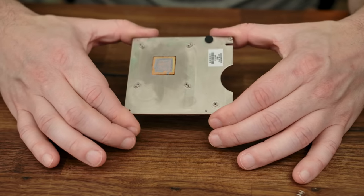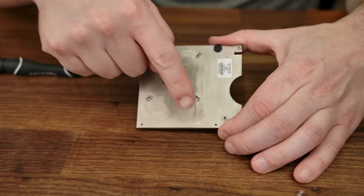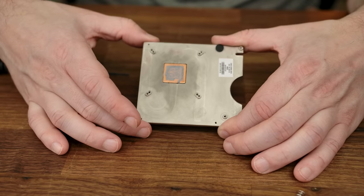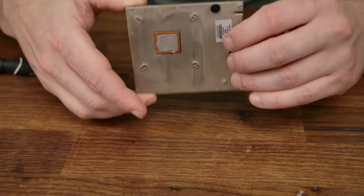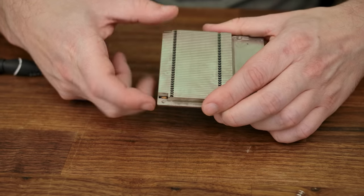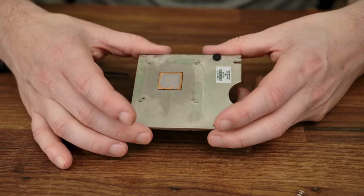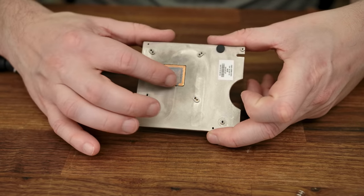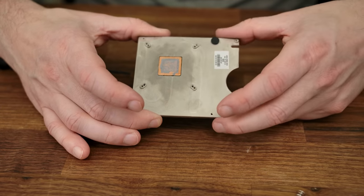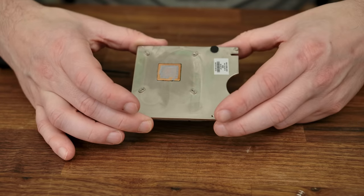Now, I'm already seeing one minor difficulty in completing this project. You see this smoothed out region in the heatsink right here that kind of looks heat pipe shaped? There's a heat pipe inside of this that I was not aware of. You can actually see the copper sticking out right there. I'm gonna have to be really careful when drilling, number one. Number two, I hope no components get in the way of that, because that's going to be really close to where the capacitors are that I have to drill out space for. Let's hope they're further back than where the heatsink goes.